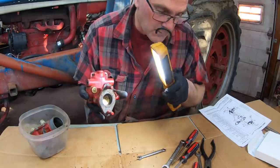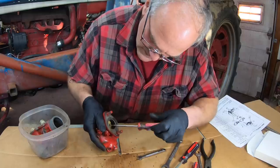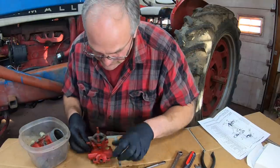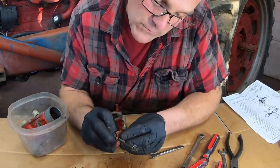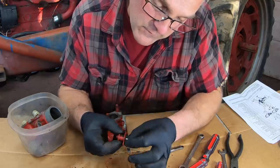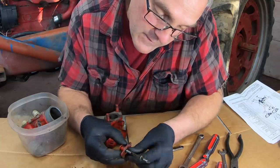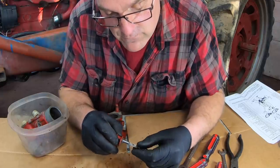Pull this plug out. Now we'll take the main butterfly off — the air inlet butterfly on the top. I'm always thankful when these screws turn out so easily. This is the main butterfly in the carburetor, which is hooked to the governor as I explained in the last video. Here is the shaft that the butterfly rides on. With these shafts — choke and throttle — you want to look for wear around where the seals are on both sides, because dust will make them wear over time. The last thing you want is unwanted air coming into the carburetor in the wrong place. These are okay, and it's a good thing because I don't have a new set — they're not available for this carburetor anymore.